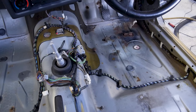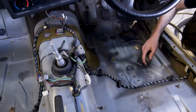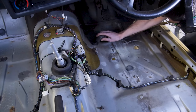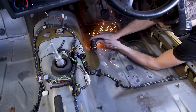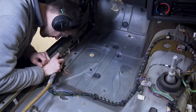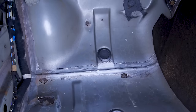With that done, I can now see all of the spots that need to be dealt with. I'm going to grind down all of the surface rust to bare metal and protect it with zinc primer for now. I like to start with steel wire bits as they remove most of the loose rust and are less damaging than sanding discs, then come back with a 36 grit sanding pad to grind down the rest until I reach clean metal. I've left all the welding repairs as I'm going to come back and do them all in a single episode — possibly even the next one. The throttle pedal bracket and the two front jacking points will be done when my order arrives from E30 Garage Norway. I found another bad spot next to a piece of vibration dampening that will need welding too. With the right side done I can do the same to the left, and with everything but the bad rust gone, I can protect all the bare metal with zinc primer.